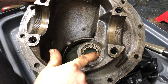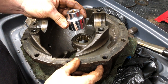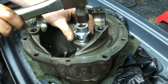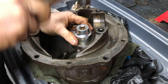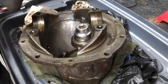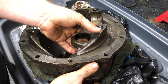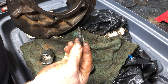The last thing I needed to do was remove the pinion pilot bearing. I was able to do this by using a socket that was just the perfect size, so I just tapped on it with a hammer until the pilot bearing dropped out the other side. Here you can see the pilot bearing and also the little clip that holds it in.